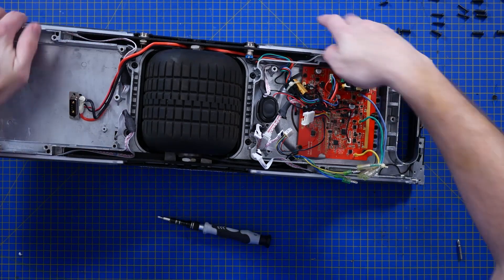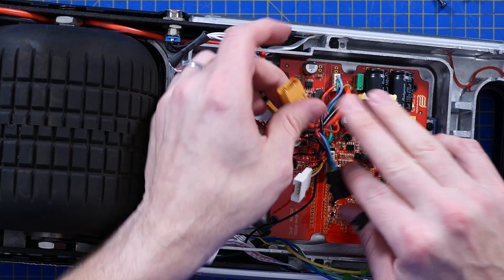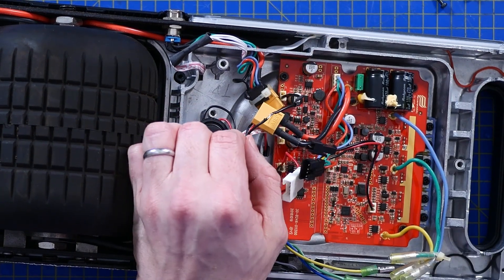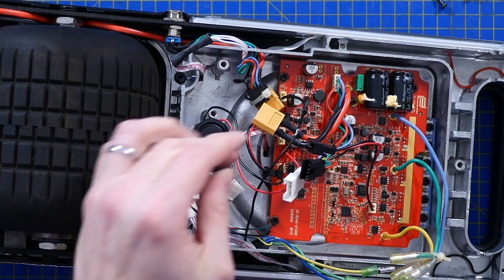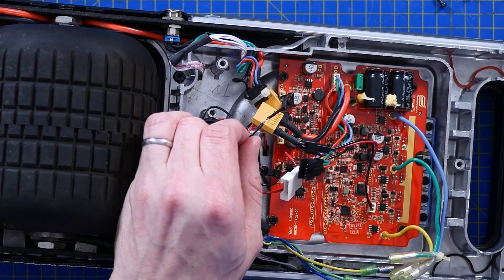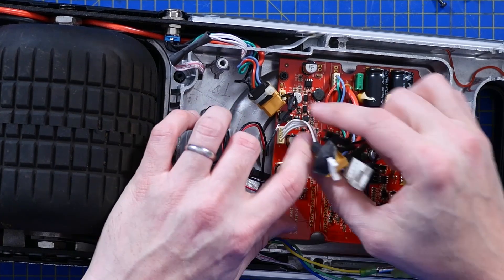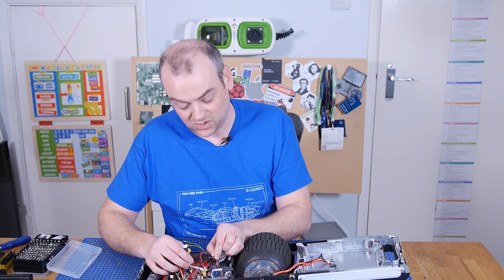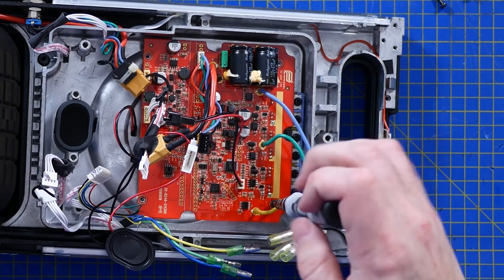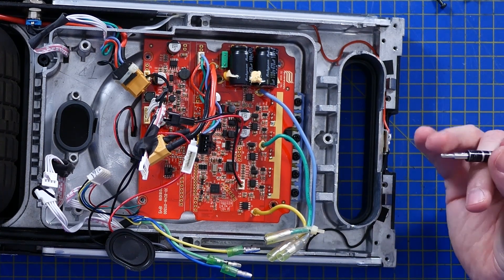Is it fair to assume these do the LED arrays around the side? There are loads of them. It's a very standard battery connector — the kind used in RC planes and cars. It has this single wire with a connector on the board. Weirdly, there's a soldered joint here. Was that a manufacturing faux pas? Maybe not — this fly lead could have been factory fitted to the LED strips and needed to be connected to the board assembled elsewhere, so that may have been a designed soldered connector. There are a lot of unpopulated headers on this board — they all look like 2.54mm headers, marked with J's as headers or jumpers.